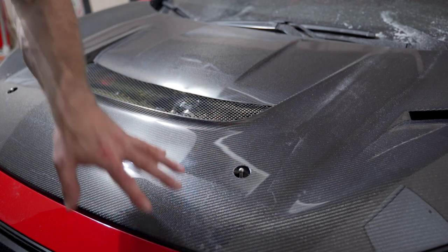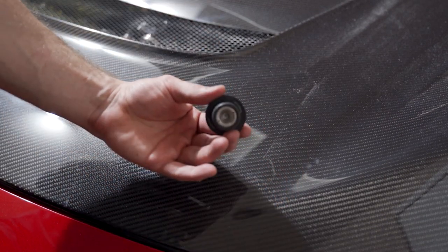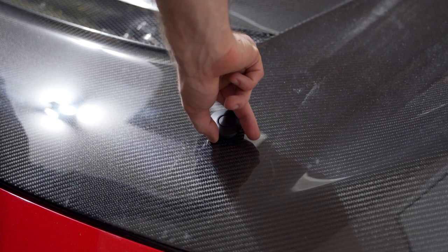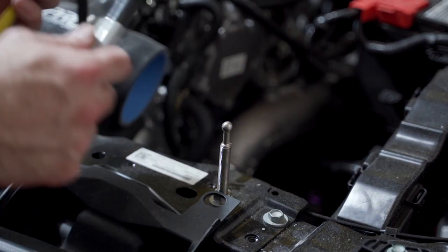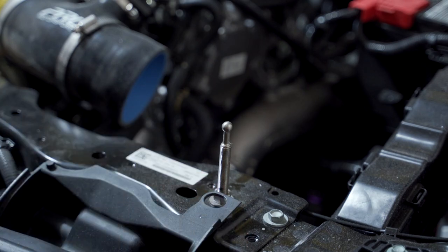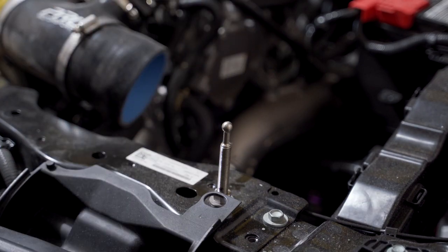With the latches test fitted we know they fit and align. Now I close the hood without the latches installed and check that the pins come up through the center of each hole. More importantly, I need to determine how much height needs to come off — the hood isn't shutting all the way. I place the latch on top and measure: I need to lower these almost half an inch but not quite. I mark the measurement with a ruler and sharpie so I know when I've lowered it enough, then I'll measure the height and make the other side identical.